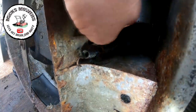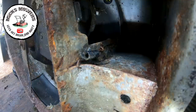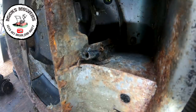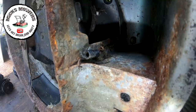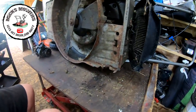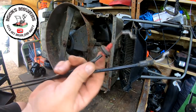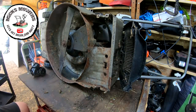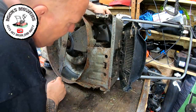Okay, now I have got a belt in here, which can go on. That'll be fitted last. I'm going to take the blade off to sharpen the blade and what have you anyway, so that'll be fitted last. So I have also removed the cables from the machine as well. They've been done off of a donor, and on these Ryobis, the red cable is the one that goes onto the drive. Okay, so you've got a dead man and a drive cable, and this red one with a grommet on is the one that goes onto the drive. So we want to loosely thread that through, and that's already got a grommet on it, so I may have to pull a grommet out to get it to fit. We should see.